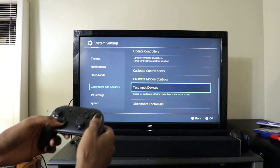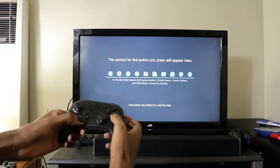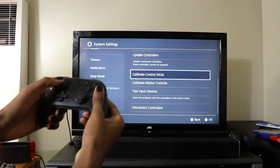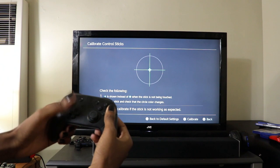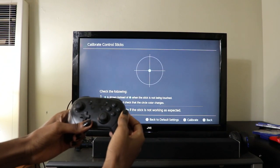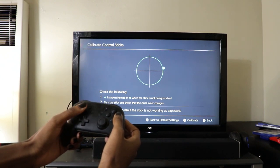The first thing I noticed is the light came on, which is good, and I'm going to test the buttons to make sure I didn't mess up anything else on the motherboard. All of the buttons seem to be functioning. Now I'm going back to the calibrate control stick option to see if it works. I'm resetting it back to factory settings because I tried recalibrating it to fix the issue before replacing the piece. As you can see, the controller is not moving on its own anymore — it's not falling back down, it's not fighting me anymore. The controller is fixed.